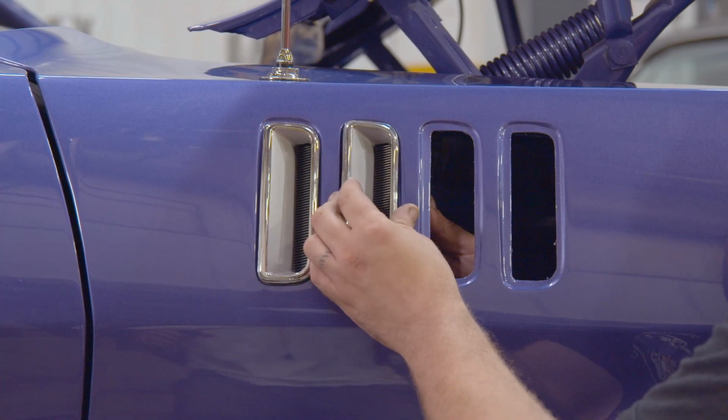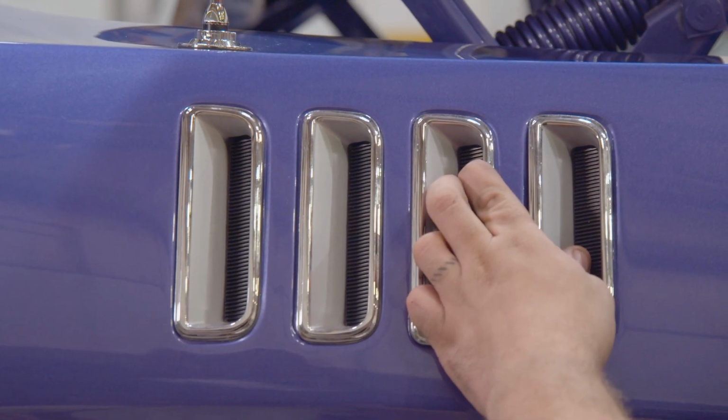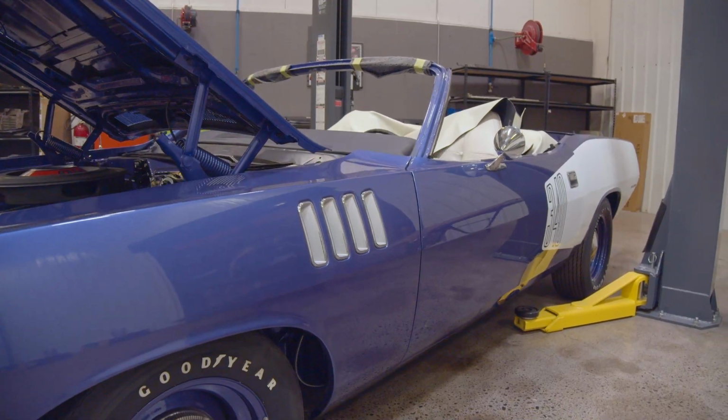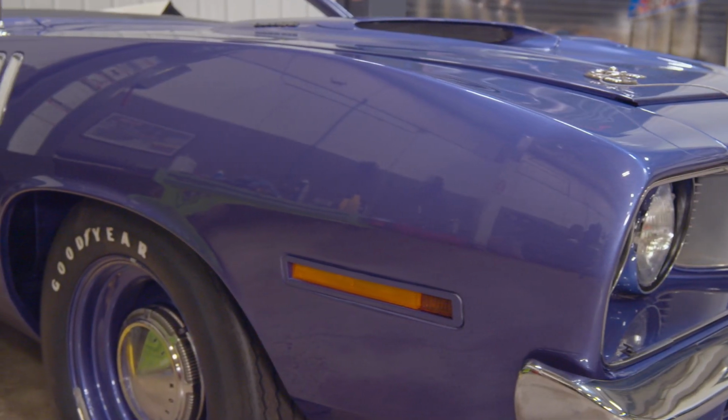Most of the cars that we don't replace the exterior trim on, we have to recondition it. We sublet it out to a guy in town here that does metal straightening. It usually needs to be straightened, usually has anodizing, has to be stripped and then re-anodized or stainless, and takes a certain hand to do that. So this was the kind of thing Justin could do. I spent some time with him before on several other cars and showed him. It's a pretty humble little setup we have, but it works great on this stuff, and it allows us to control the end result, the finished product, as well as the time to get it done.